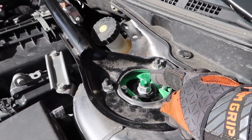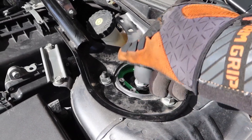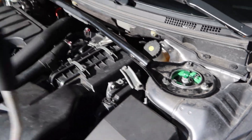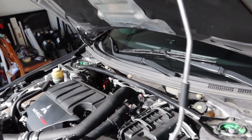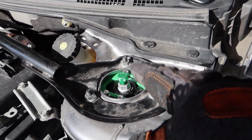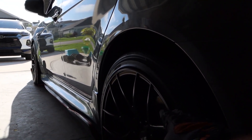I don't know if I mentioned this in the coilover install video, but there are 32 dampening settings for softening and hardening. What I did was bring it all the way to soft, maxed it out, and then counted 20 clicks over toward hard - and I did that for both sides as well. We'll go ahead and test out the ride once everything is installed. But just in case I forgot to mention that, I wanted to tell you - now time to work on the rear.